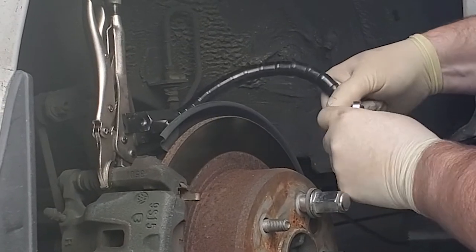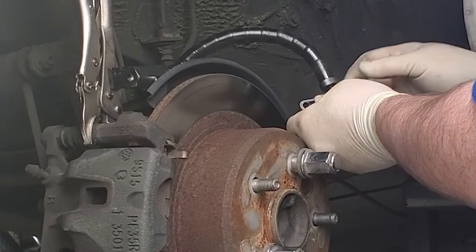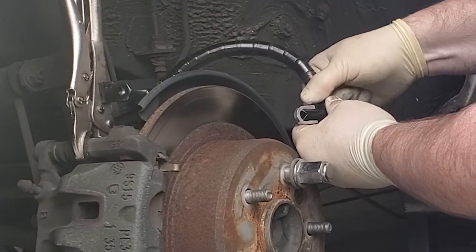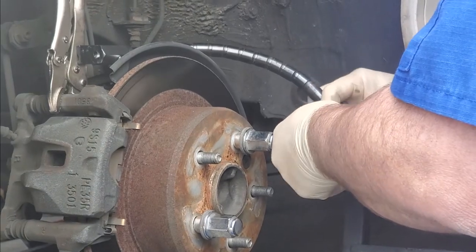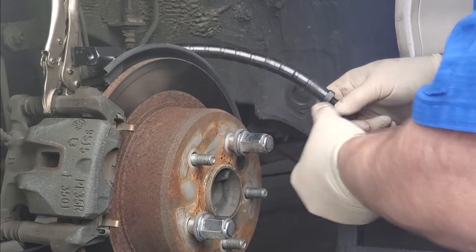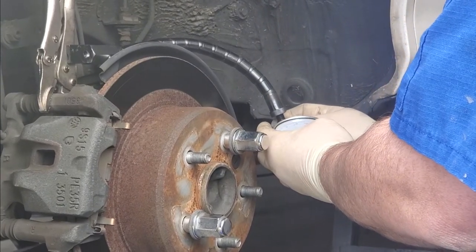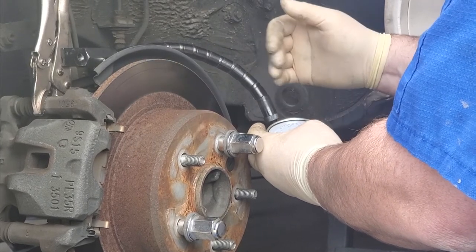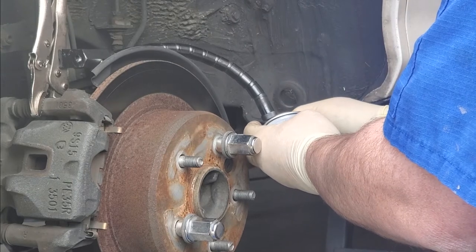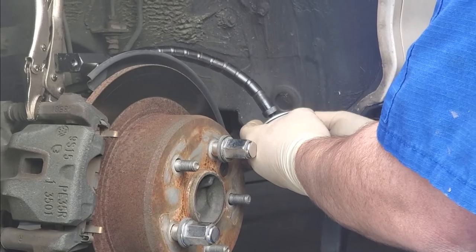Tighten up the snake with the collar. Take your dial indicator — I don't like setting it up right at 90 degrees because it will tend to vibrate against the metal. So we put it at a slight angle and then just kind of tighten it up. It doesn't have to be super tight, just tight enough to hold it.